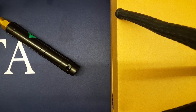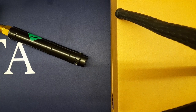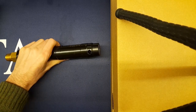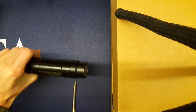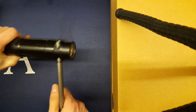Now we're going to service the front area first, because this is where most leaks come from and what most people will be doing. We're going to put this in a vise — careful not to clamp on any of the bridges, just clamp across the middle with a soft vise — and use a correctly-sized bar through the filler port hole. Usually these are on quite tight, so it is going to need a knock. We hit it with a hammer to shock it open, and that's knocked off — it just unscrews from there.